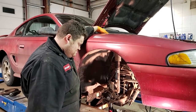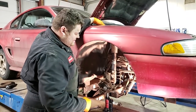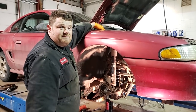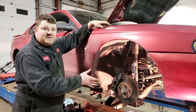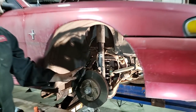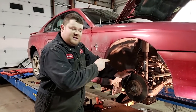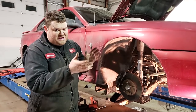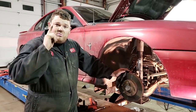Next steps are to tighten up some bolts, throw the rotor and caliper on, throw our end links back together, put tie rods back on, put wheels on, then tighten the underneath fasteners. If you're working on jack stands, use your floor jack and a block of wood — don't try to muscle this together or fit a spring compressor in there, it's just a waste of time. A spring compressor is only good with factory ride height springs. We now have the entire thing buttoned up: springs in, struts in, end links, tie rods, all done. Last thing is to put a tire on, set it down so it's got full ride weight on, then tighten up the lower control arm bolts with ride height set so you don't have any binding — always good standard practice.